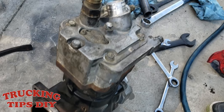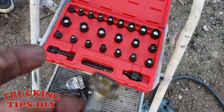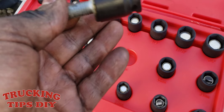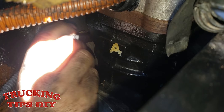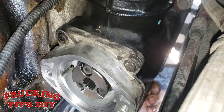Now we're just gonna bring it up there and start putting in the four bolts. We already put three bolts for the compressor and we've got the last one here. For this last bolt I'm going to be using a magnetic socket — you might want to use one of these to make it easier. It's 16 millimeter, as you can see it has a magnet. All four bolts are in and we're just gonna torque them down.